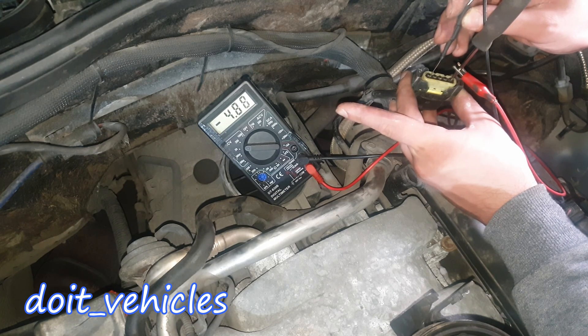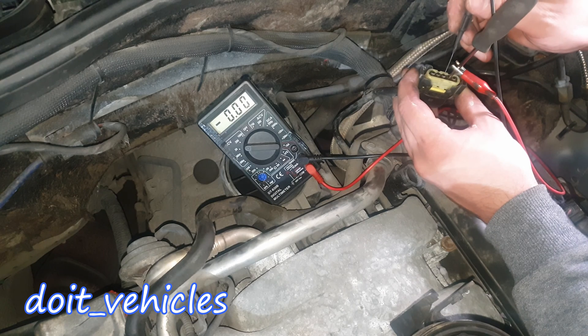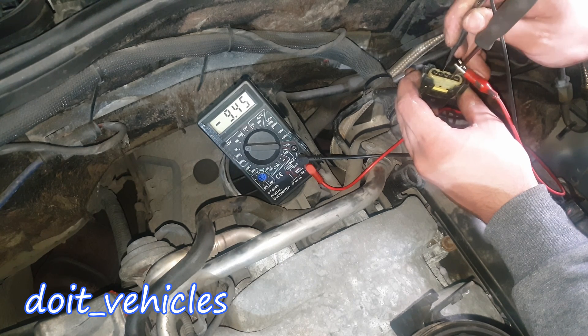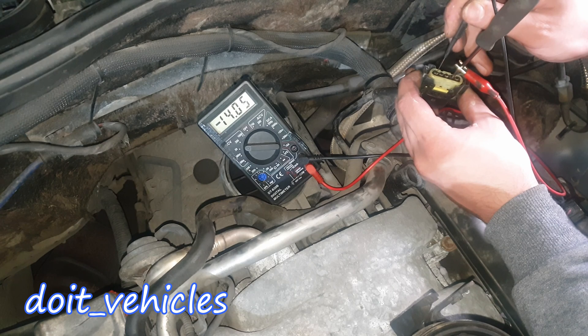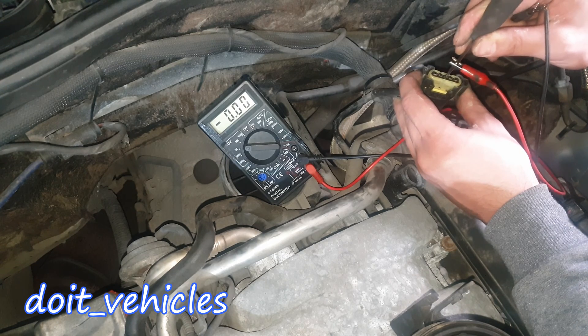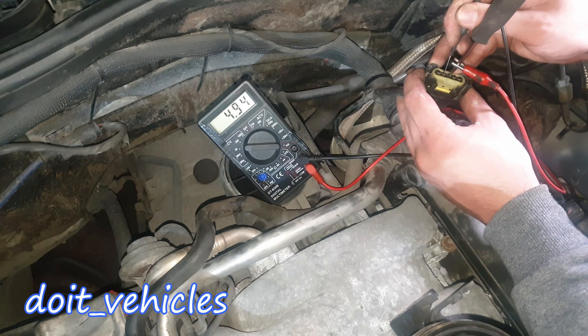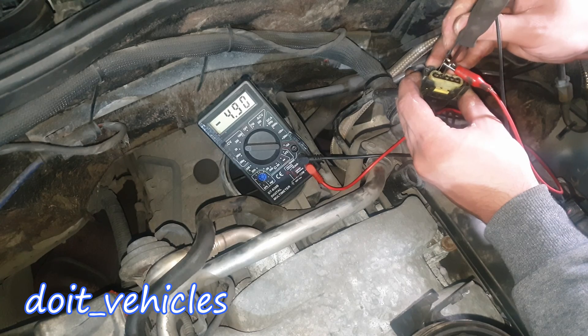Keep in mind that when you see a minus on the screen the polarity is reversed. Now let's put the red terminal on pin number 2. Between 2 and 3 we've got the car battery voltage. Keep in mind that I've got the car battery on a charger, so the voltage is increasing. Between pin number 2 and 4 we've got 9.5V. Between pin number 2 and 5 we've got the car battery voltage. I actually recommend that when you do this test you've got a charger on your car. Between pin number 3 and 4 we've got 4.9V, and between pin number 4 and 5 we've got almost 5V.